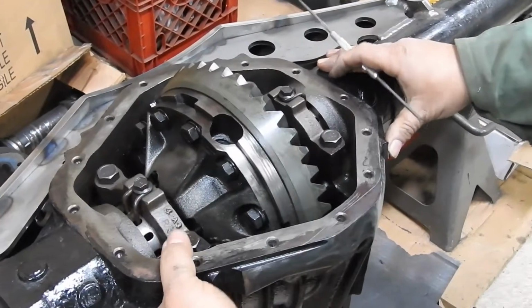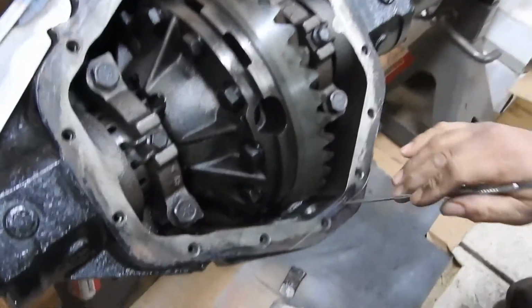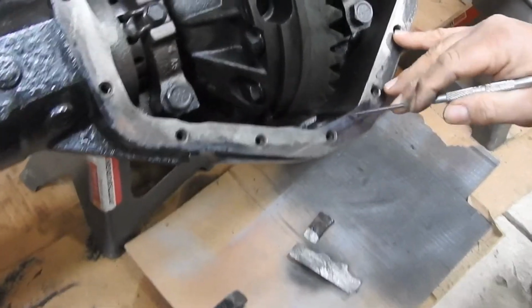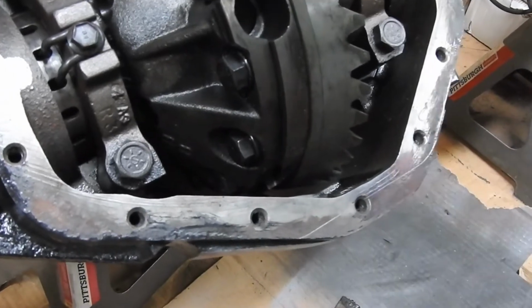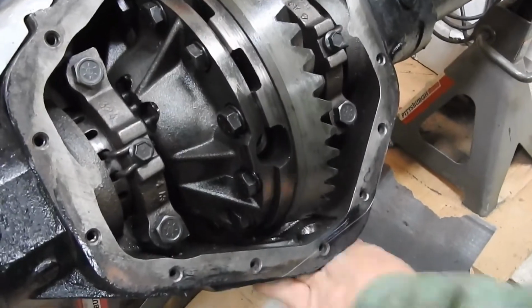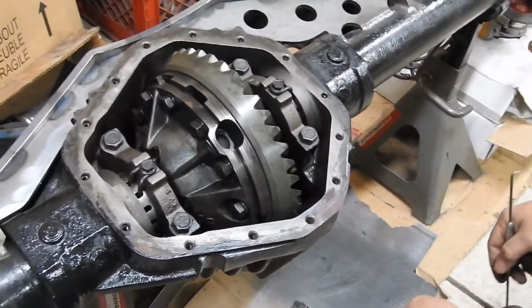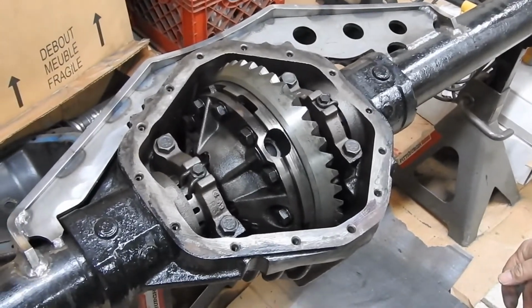But something to think about is this: if you decide to cut without checking those clearances there, if you straight cut below here, you're not going to have enough thickness to hold in case of bouncing off a rock or you hit a rock at speed. You're not going to have enough material that can hold that impact into your axle. Well, not a big deal for some people, but for me it is.